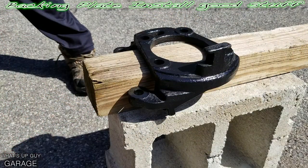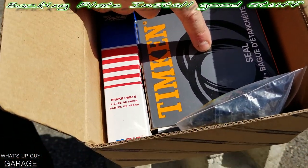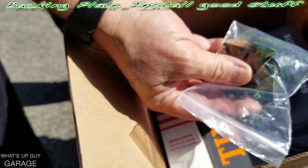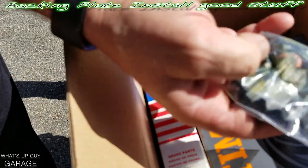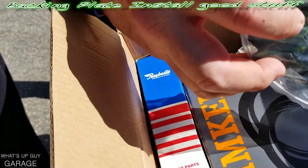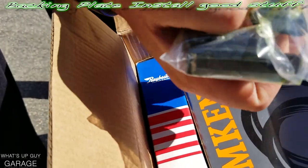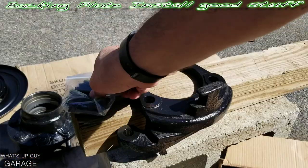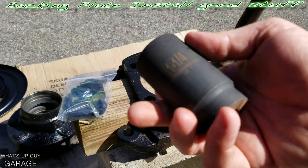We're all cleaned up and painted. In this box we've got our Timken seals, all our brand new spring brake hardware for the parking brake, and the boot for the parking brake assembly that slides through it like a rod. You've also got the little slotted piece for adjusting the brakes. Obviously we need our socket — we're using the inch-and-a-quarter because it leaves plenty of room for that bolt.